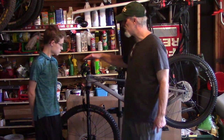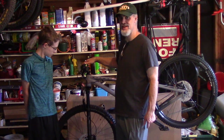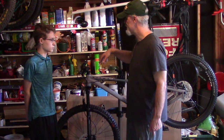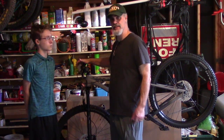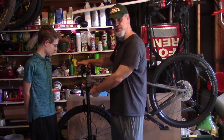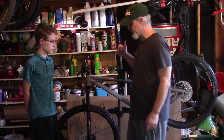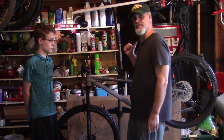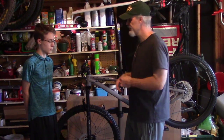One, the brakes are not in the right place. It's not American style, it's European style. Since the bike came from Europe, I guess that's what's up. So the right brake typically stops the rear for us, but in Europe it stops the front. And the left, for us, would stop the front, but for them it stops the back. And so we need to swap those.